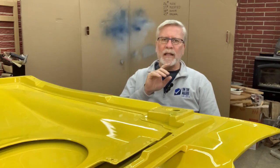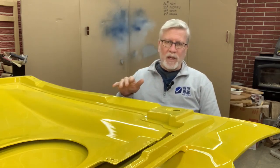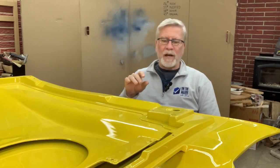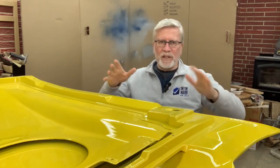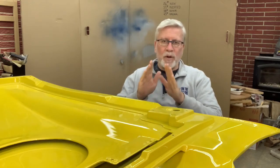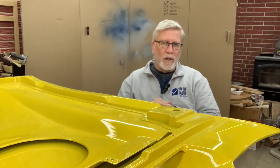There are a couple of terms that I used incorrectly. There's fiberglass resin that I used to put the fiberglass cloth in. I didn't use any fiberglass mat. Fiberglass mat is the stuff that's just a mishmash of all directions. It's just a mess. The stuff that I used was actually woven. So that is fiberglass cloth. I put that in with fiberglass resin. Now, I also referred to fiberglass epoxy, and really that was just epoxy.